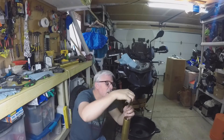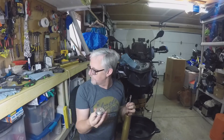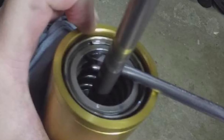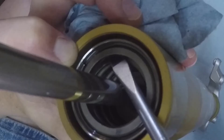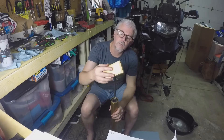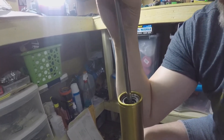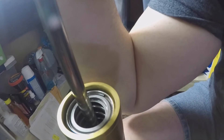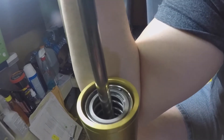I have a piece of wood with a hole drilled in it that's a bit bigger than the shaft of the pushrod, so I've got a way to easily have it on here. I'm just going to push down on the block of wood, and as I do so, the spring is getting compressed, which is releasing the tension at the top. You can see there's a circlip there that has to be removed in order to get the metal spacer out that holds the spring in.